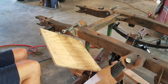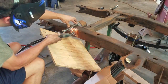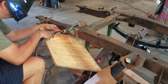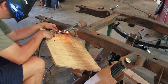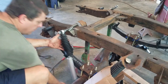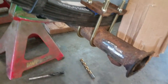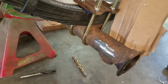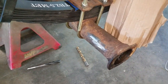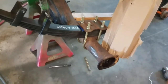A couple of tacks — the board is in the way so I don't want hot metal all over my new springs. I've got my axle tube prepped so I can tack the bracket on. I'm not going to weld it out fully until I can pull the housing back out and do a really nice weld, but my focus today is the frame bracket placement.